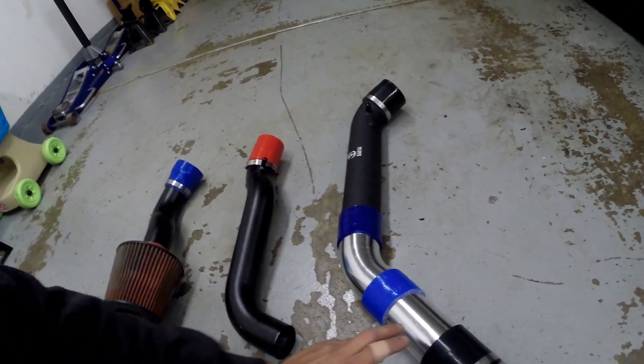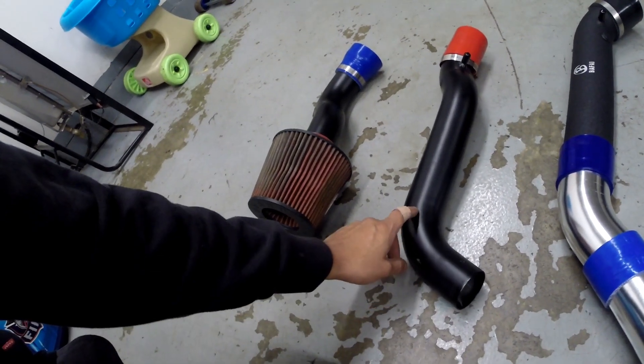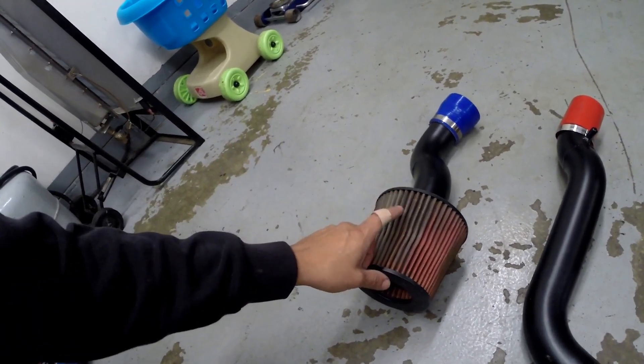Idle temperatures for the three inch with the velocity stack was around 100 degrees. Cold air intake with the two and a half inch was around 110. Short ram with the two and a half inch intake was 120. So it was about a 10 degree difference at idle between each setup. Cruising speeds showed a drop of around 10-15 degrees, and I believe wide open throttle would possibly be like a 20-25 degree difference. All of this was done at nighttime around 11 p.m. with temperatures around 50-55 degrees outside, no humidity - fall, the month of October.